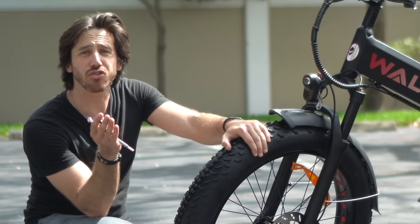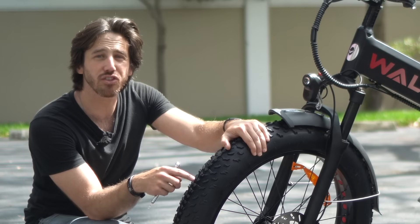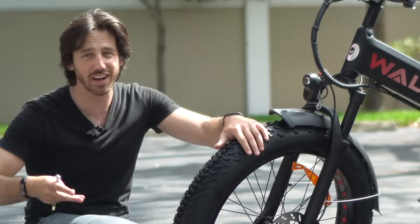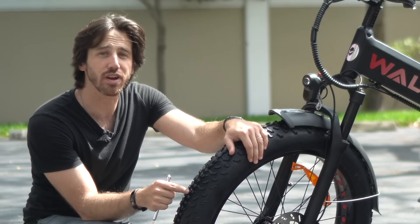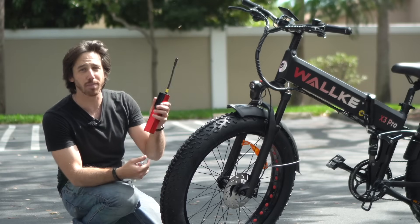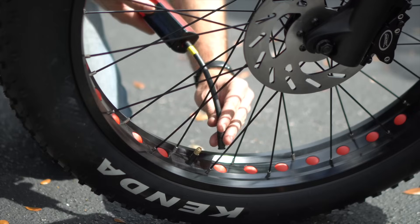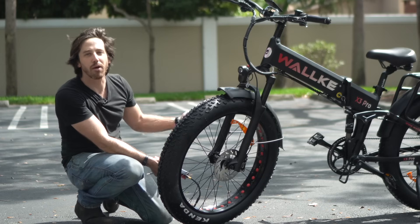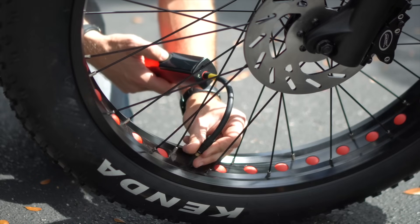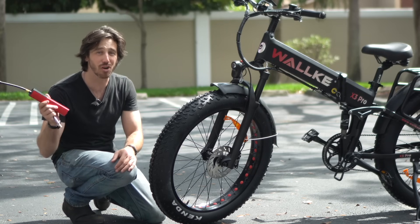The problem when you get your tires too low, especially on road, is that you significantly impair your handling. If this front tire is too low and you go to make a turn, you could end up with your tire one way and your body another — it's just not good. So make sure you're keeping up with your air pressure, especially on that front tire; getting it too low can be quite dangerous. I like to keep one of these battery-powered pumps around — just screw it on, push the power button, and it starts pumping. You can set it for the exact pressure you want, and you can generally get 10-15 fat tires filled with one charge.